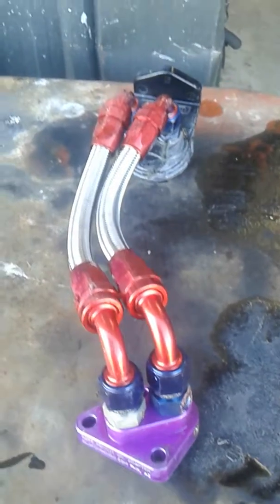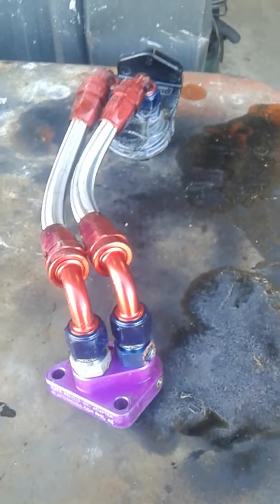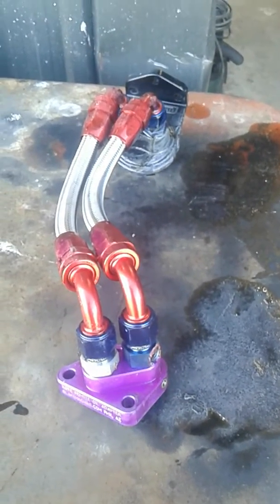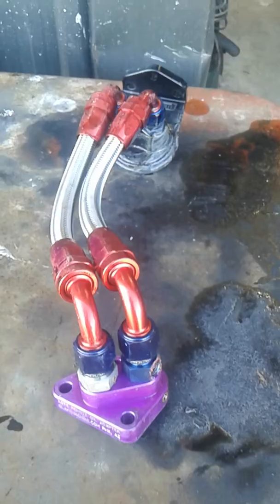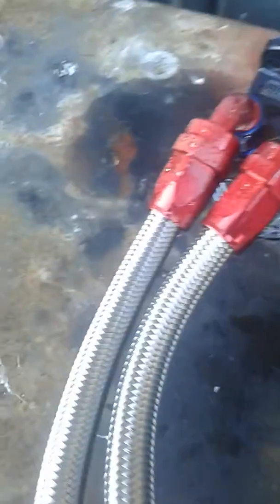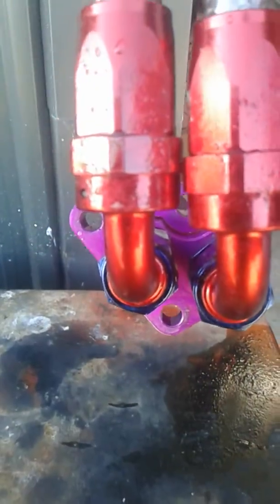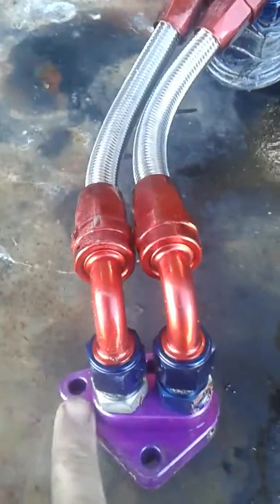This particular vehicle was a bit tricky because the oil pressure switch itself had an issue as well, so it showed that it did have pressure, but it had a little bit of a rattle on startup. Didn't sound right, so I knew something was up. If we have a look here, we've got the oil filter housing that bolts onto the engine.